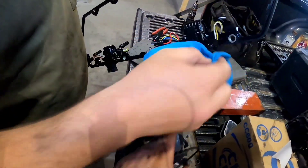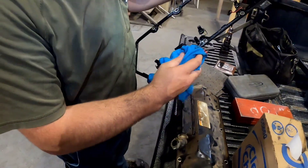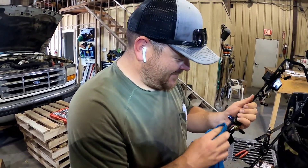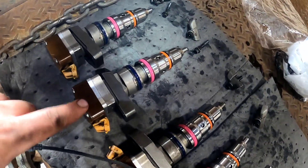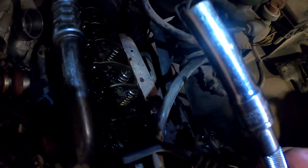He's gonna wipe down these valve covers. When you pull something out I like to sit it by the new injector you're gonna put in — try to keep things as organized as you can because it's pretty easy to lose stuff when you're putting injectors in. A 10 millimeter long socket will reach in and take your glow plugs out.